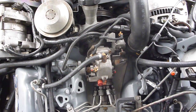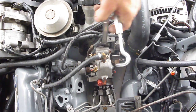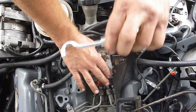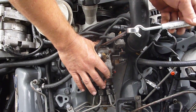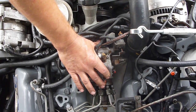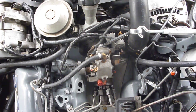With two nuts still tight, I like to take a three-quarter inch wrench. There's a square tab on the front of the pump you can use. Take a turnbuckle — I bent that side so I can hook it around my fuel pickup line — and that holds the pump nice and tight. So when I loosen the other two nuts, the pump doesn't move, but more importantly I can move it. I'll grab my wrench again; these two are a little easier to get to.